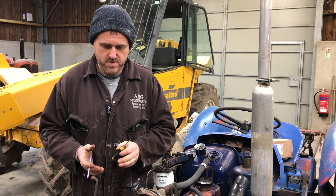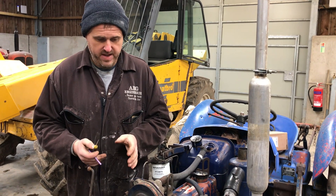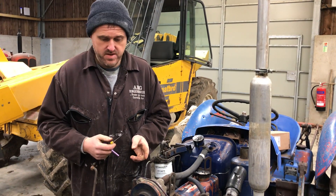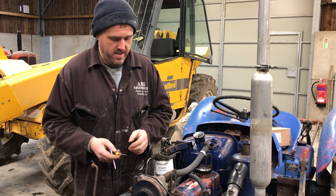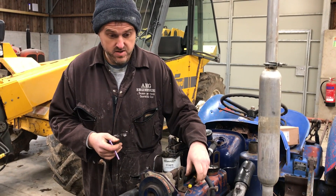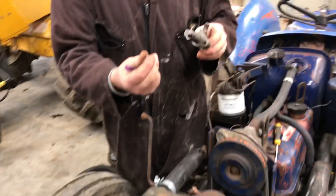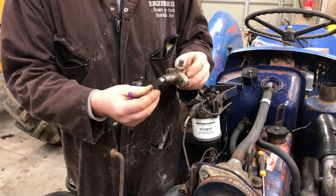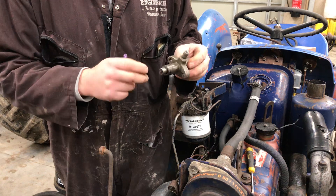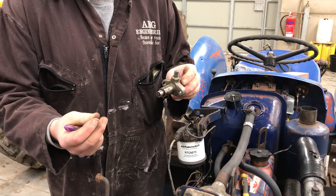We're doing a short film to give people instructions on how to fit injectors to a BMC 950, 1500, or 1800 BMC diesel engine. One of the common failures with the injectors, or when people refit them, is they put the corrugated little heat shield washer in the wrong way. When this happens it causes the injector nozzle to fail and makes the needles stick inside.